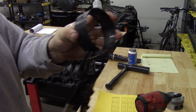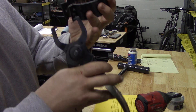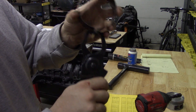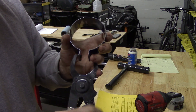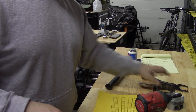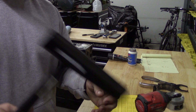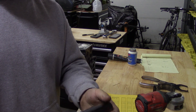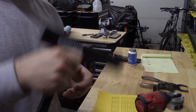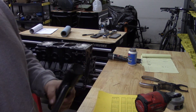This one's actually a Blue Point — it's got a 3 and 3/8 to 3 and 5/8 piston ring compressor on it. It's a very cool tool — it's a ratcheting one with different inserts for different pistons. This is awesome; I use it all the time. The generic one from AutoZone or Harbor Freight with an Allen key that you twist works great too, but this is the one I use. And then my piston hammer — literally what it's called. I got it off Amazon too. It's really great for pounding pistons into the bores nice and swiftly, rather than using the butt side of a hammer. It wasn't too expensive — it's a Mountain brand. I don't know how great that is, but it's held up for me.